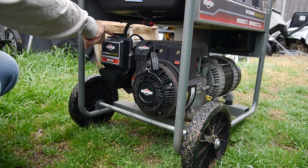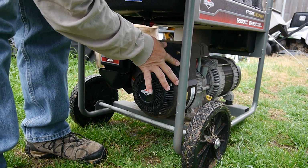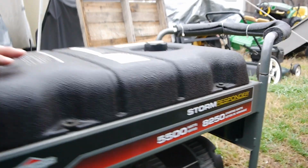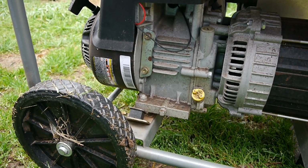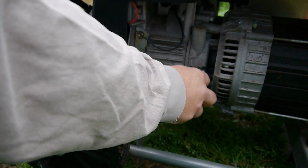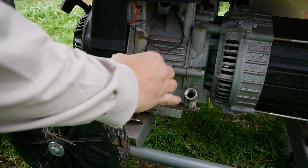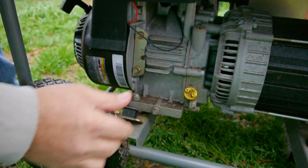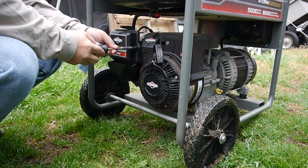And if I'm not getting any spark, then I can check the switch, and if that's fine, then I can check the oil, if the oil level is fine. Because this one, I do believe it probably has that safety shut off, right? So if it gets low on oil, yeah, it's not low, I don't think. I think I can see it right there. Yeah. Looks like it does need an oil change. But, yeah, so first thing, let's get all this off.